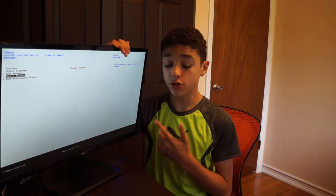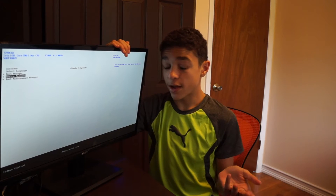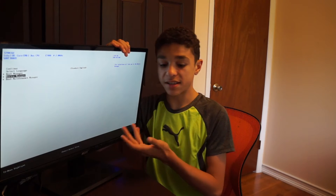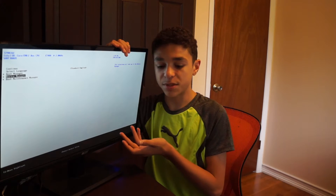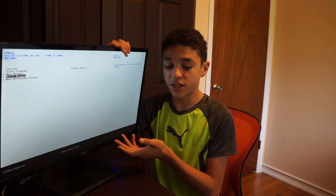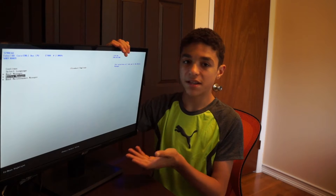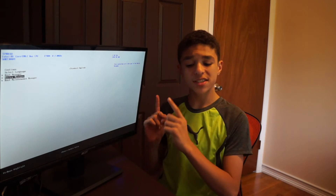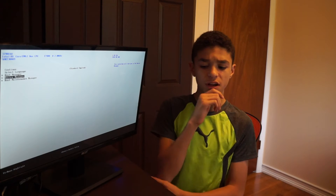I ran into initial problems very quickly. Firstly, the BIOS doesn't support the AHCI SATA configuration, which is required by OSX. When I attempt to boot using the bootable media and attempt to install it, it's not going to be successful — it will not successfully install or boot because it's using the incorrect SATA configuration. So I thought to myself, what if I install OSX on the drive using a computer that's already set up with the AHCI SATA configuration?